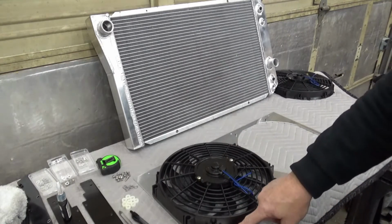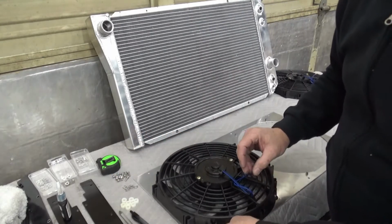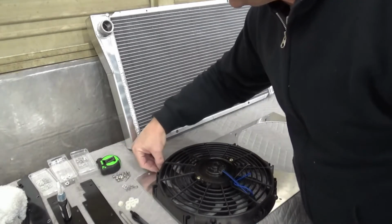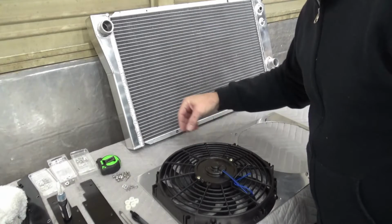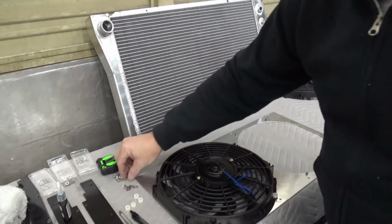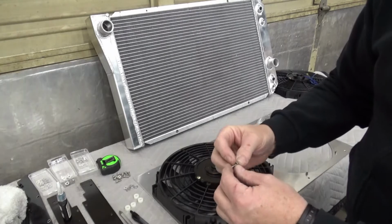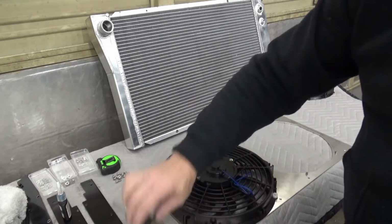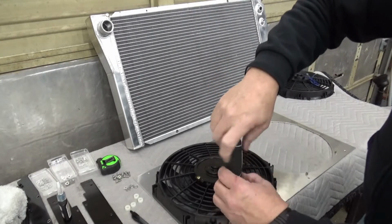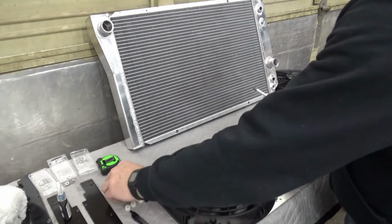Now if you'll notice, the nut is still higher than the plastic is, so I got these little nylon spacers, and we put those on here. And then I'll use an 8-32 by 1/2 stainless steel screw, and with a flat washer, that just screws that down nice and tight.